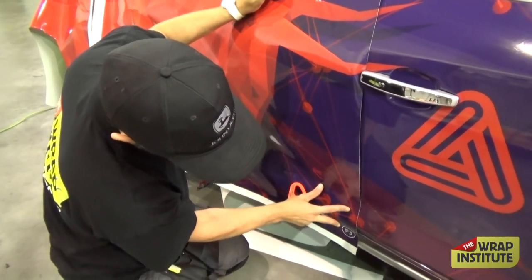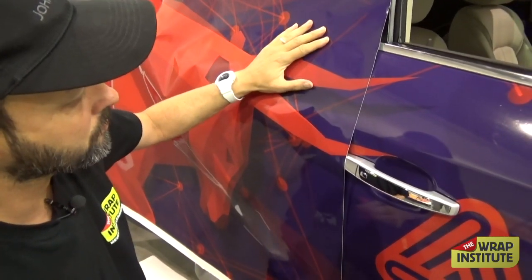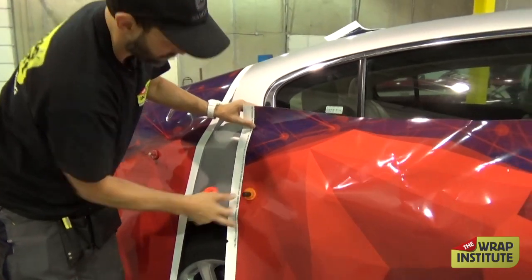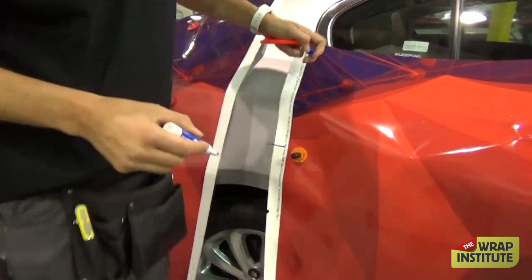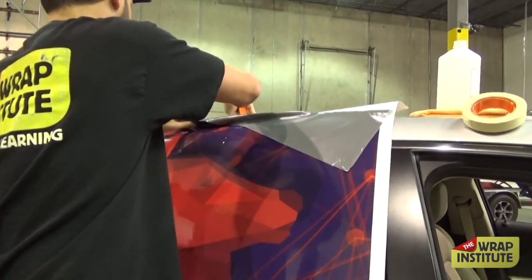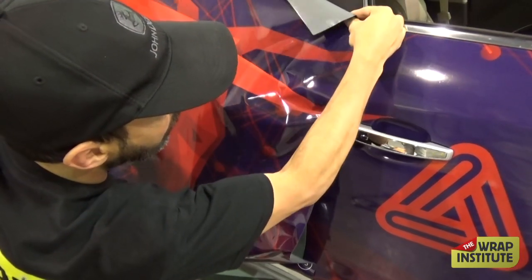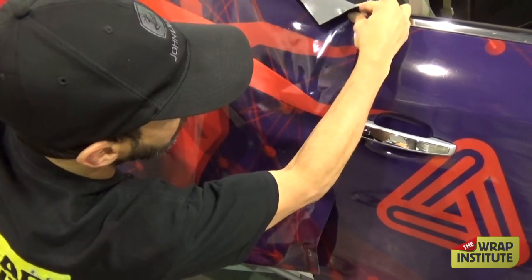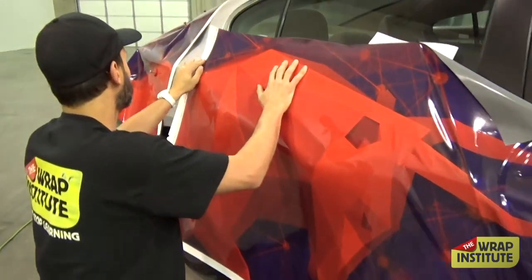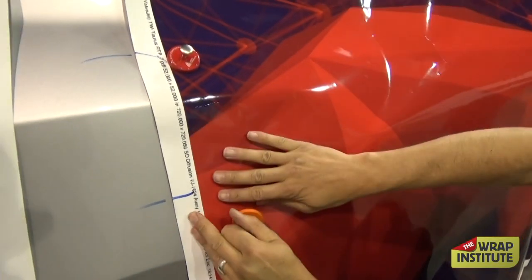Move the masking tape, add new masking tape to the passenger door and back door. Now registering — this is a big question at workshops. I'm going to do what's called the triple hinge. Set the bottom up, set the top up with magnets, get it roughly in position. The overlap on the door is about five to six inches, which will be cut off. Even with a direct overlap, still do a triple hinge. Set up a magnet, do water-soluble pen marks in case it shifts. I release the backing paper and start where the hinges are, since the door handle is on the body.